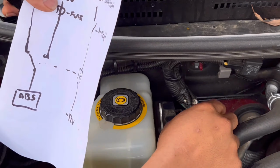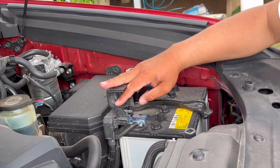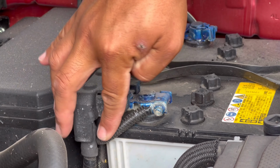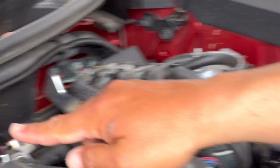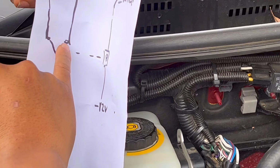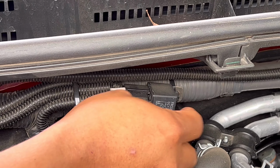Then we run a... Can you show him the cable, Glenn? Yeah. So we attach a power source directly into the 12 volt battery, with a fuse, and the fuse is over here. And then this one runs all the way to the back into the normally open pole of the relay. That's the relay over there, the square thing. So we put in a double pole, two-pole relay.